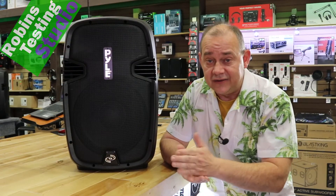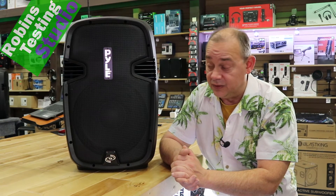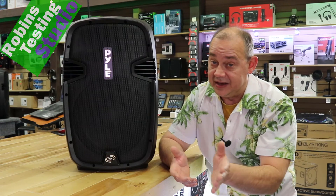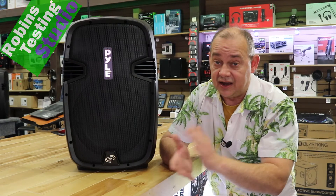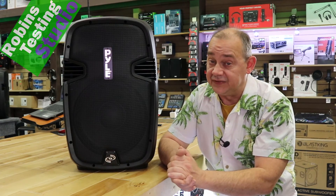For sound quality — great for live use. If you're playing back for a party, you may want two of them. They are very loud: 12 to 15 people per speaker. I wouldn't use just one speaker in a backyard for a dozen-plus people. Remember, it is a woofer and a tweeter, not a subwoofer. So if you want that big bass, don't mix up loud with bass. It's bassy and has great sound, covering the full range from 20 Hz to 20 kHz. But if you want really solid, pounding bass, you're going to need a subwoofer for that.